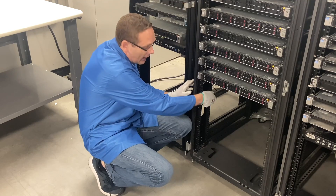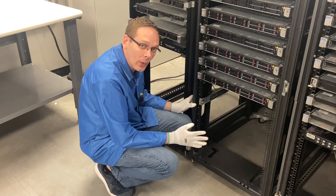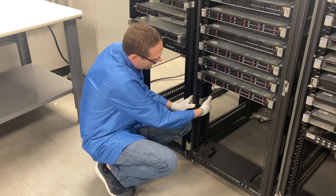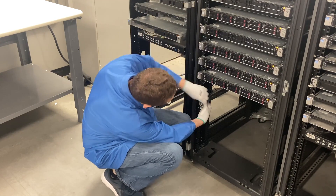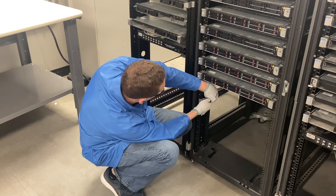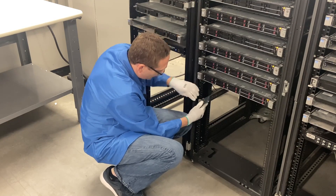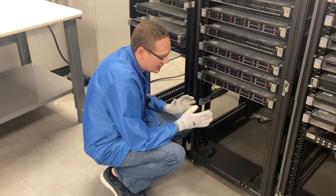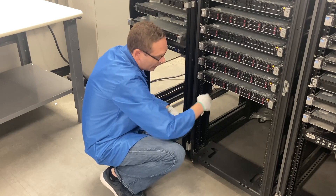The inners will come out of course, but the actual kit is locked into place. If you want to remove it, the design is not quite as good as Dell's in my opinion, because you actually need to come on the inside of the rail itself — there's a clip you push in. When you push that in, the rails will pop off. You can push those two prongs back in to lock it back into place, but taking it off is kind of a pain because you do have to go to the inside of the rail.